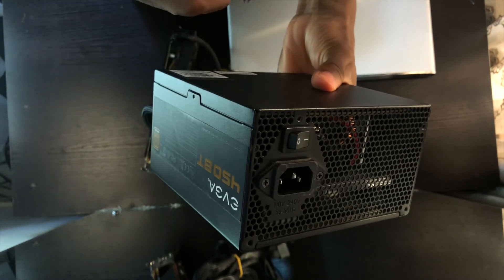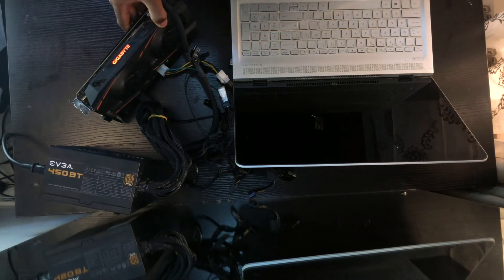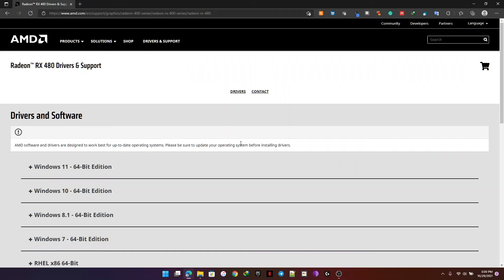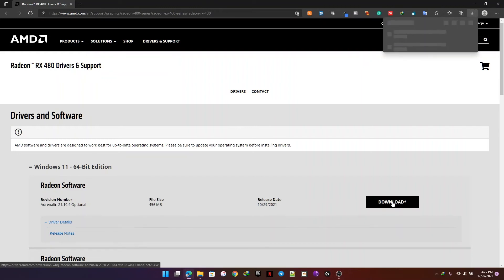At this stage you'll need to remove your laptop's back panel to access the internal components. Once you have access to the slot, connect your connector there. If you're using the Wi-Fi card slot, remove your Wi-Fi card — this is the part where you'll lose your built-in Wi-Fi. Connect the connector, screw it in, and close your laptop back. You'll notice I have a cut-out in my laptop's back panel because the cable needs to come out. I had to cut a small strip of metal to allow the case to close with the cable routing out.